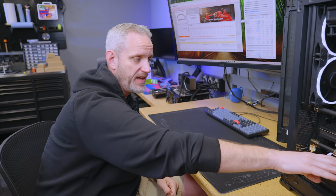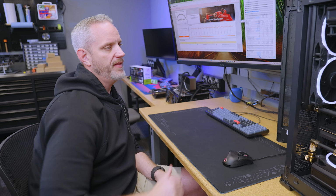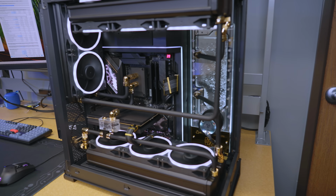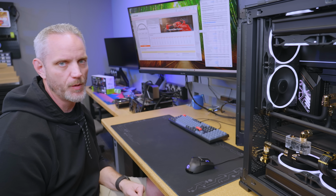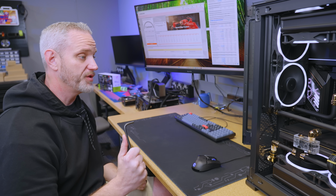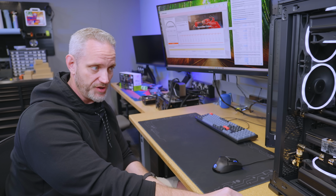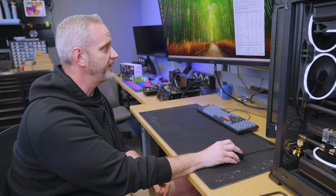So that was just the GPU getting basically idle speed on these fans with the push-pull on the top and the standard pull on the bottom and the pull on the side. Clearly there is plenty of radiator to keep it nice and cool. Also, the temperatures in this room are cooler than my room at home typically, so ambient temperatures affect your overall temperatures, as I've explained. But the temperatures are great. 42.7C as a spike, and it was much lower than that as an average. It's pretty awesome. Let's talk about the CPU, because that is mapped to the fans.